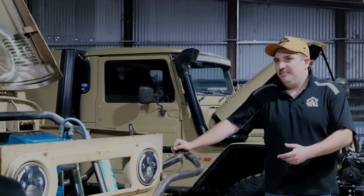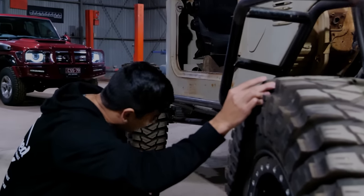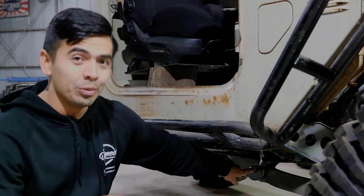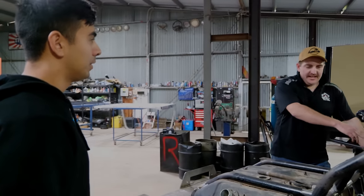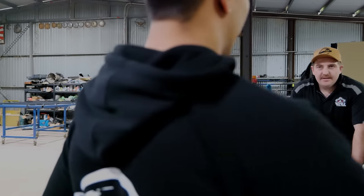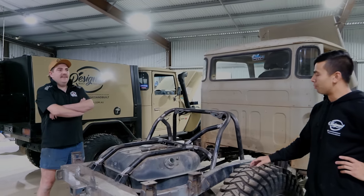Patrol is another option — it's a very similar thing. There are a few things with a patrol chassis though — all these cut and shut mounts, but on a patrol these mounts are in single shear, which is a big no-no. But an 80 Series has that dual cross member setup. The patrol mounts are just sort of hanging off the side, and you've also got to run a brake pick-off anyway. The wall thickness is better on these chassis too — about 3 mil. So you've picked the best chassis.